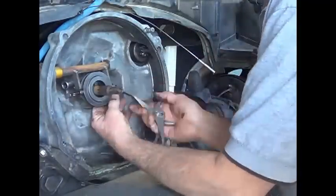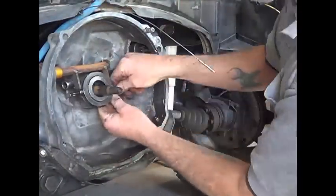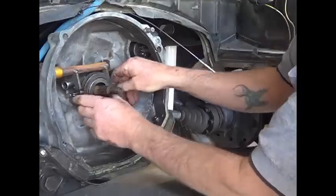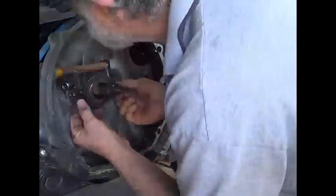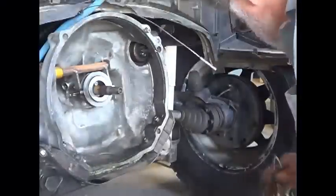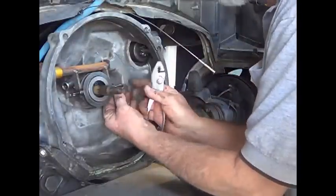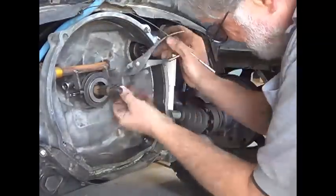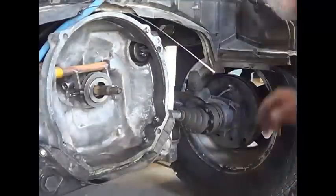This really cracked me up. I decided to try to narrate alongside this when it comes time to put these throwout bearings on. It's probably the very reason that people don't like these spring clips — it is really a hassle. I'm telling ya. The left side of that throwout bearing fit nice and snug and tight with the racer type hairpin spring retainer. The right side I kept having troubles with — I tried over and over. One of the springs felt like cheese.